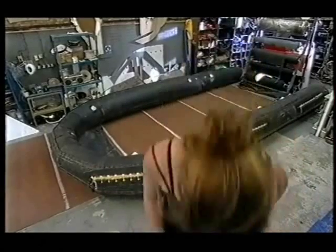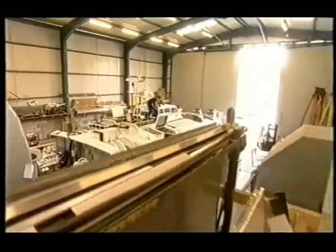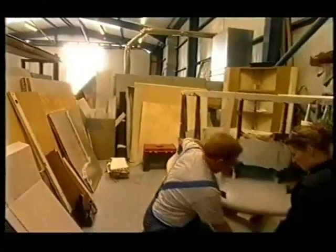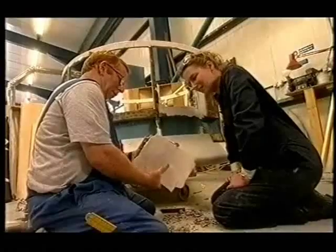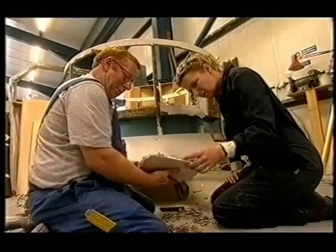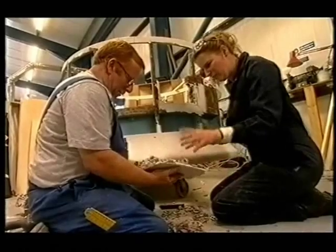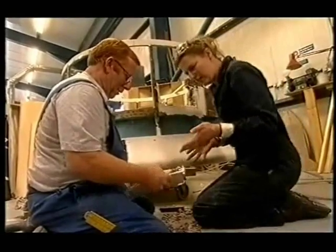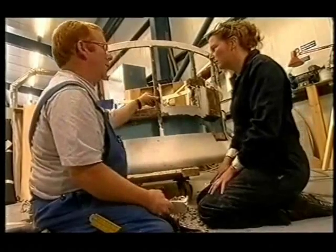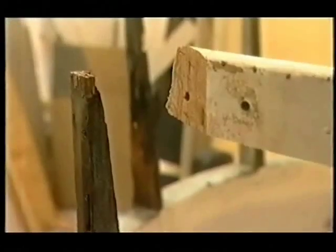Let's face it — if it can withstand my weight, the sea is not going to be a problem. Back in the workshop to inspect damage inflicted on the duct by rough handling. It's a mixture of ply, filler, newspaper, and fibreglass — certainly not the original. The original would have been birch ply over a framework, but the ply has rotted, the face is gone, some timbers are gone, and they've filled it with newspaper skimmed over with filler and fibreglass.